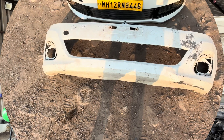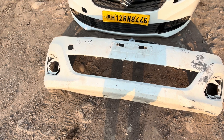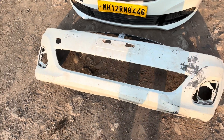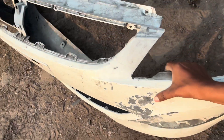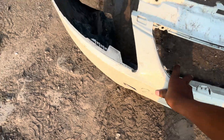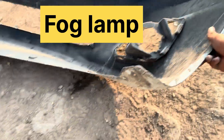This one is the bumper. From the styling surface we receive, we do multiple analyses - aesthetic analysis, style analysis - then we check feasibility: tooling feasibility, manufacturing feasibility, and assembly feasibility. Depending on that, we make it offset by the required thickness as per the plastic design guideline, then make it a closed volume. The next challenge is to integrate the features required for tooling, which requires understanding tooling feasibility and assembly feasibility together.